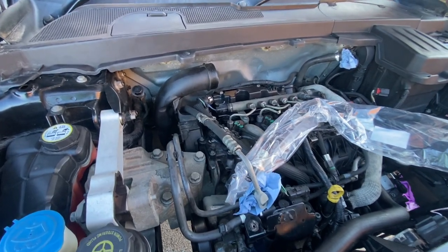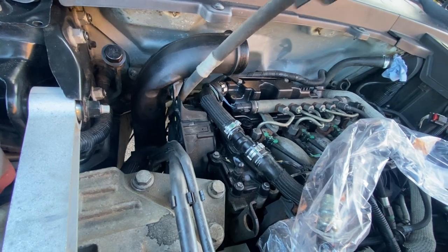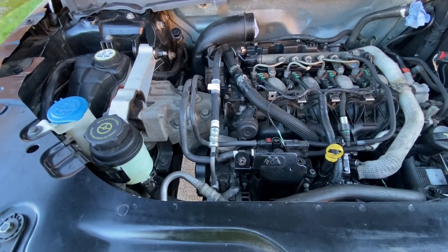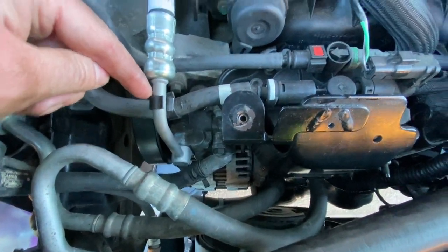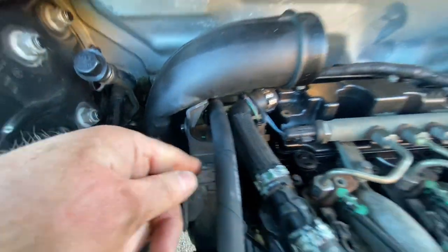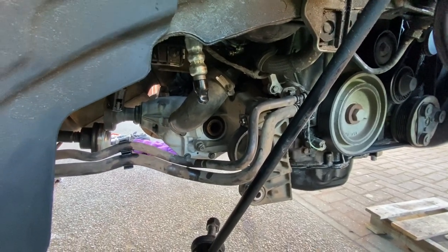Once you've got that little 8mm bolt out, you can bring the cable away. With the first hose now installed, I re-bolted it up at the bottom, popped the clip in, reconnected the bracket, and it drops down ready to connect to the steering rack hose.